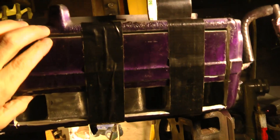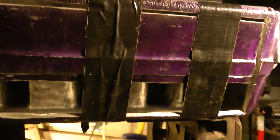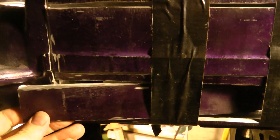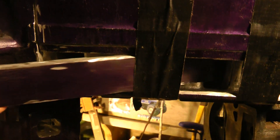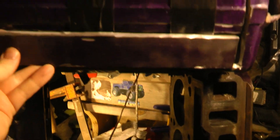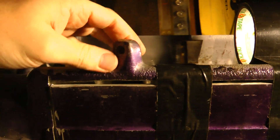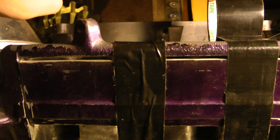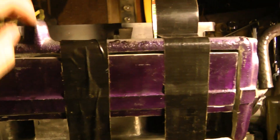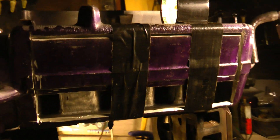As long as this is lined up properly and you get this set for a day — with the weld structurally secure — then you take your other piece. The gaps are large enough to where it's going to go right in and kind of slide into place, hopefully. Then just do the same thing with that: put duct tape on it, tack it in with epoxy, and then go around. Here's a nice point for your ground lead — obviously the paint needs to be taken off. Put your ground lead on, start making some stitches, some tacks, and then just kind of fill in holes.